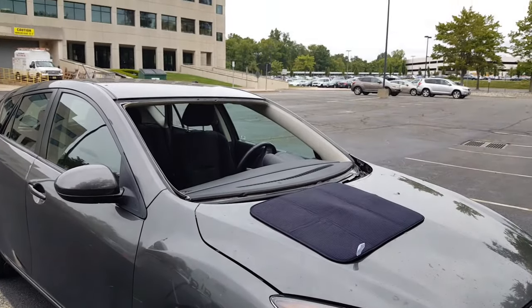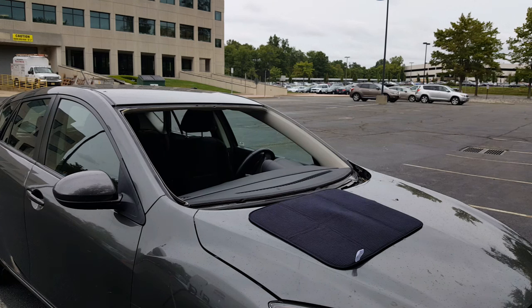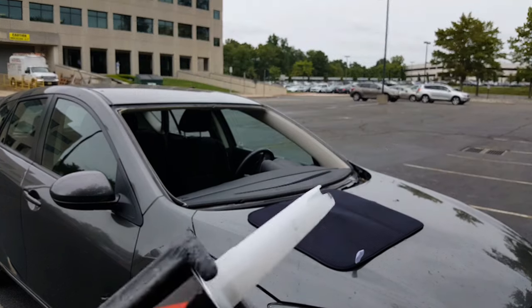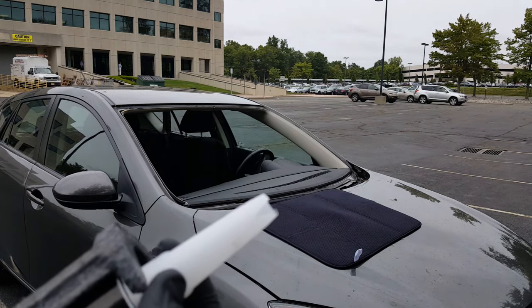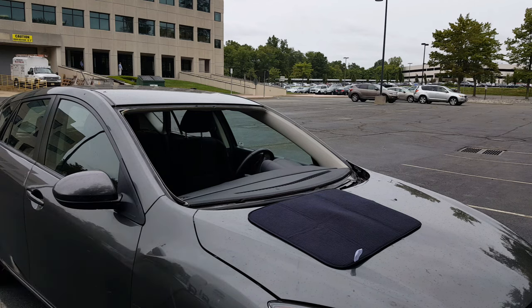All right, so the urethane that I'm going to use for this is Sika P2G Plus. It's 4 or 5 hours dry, and the car you see is going to be here till the end of the day, till 6 o'clock. So I can use that glue. All right, so I'm going to use a V-shape. I know I made a video, it doesn't really matter which one you use. For this one, I'm going to use a V-shape, just so everybody goes crazy when they watch the video.